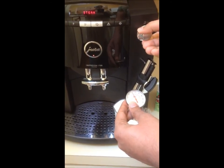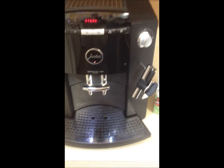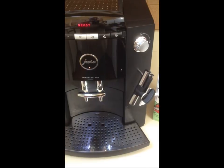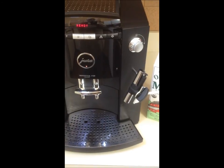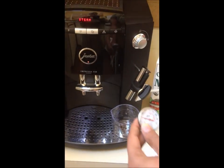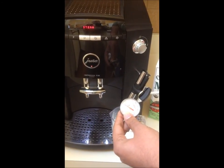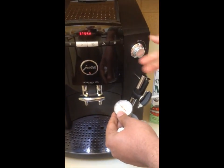The fact remains that this milk does not reach the required temperature. One reason, as a technician, I can understand is that perhaps the tube is drawing too full a volume of milk flow. As a result, the steaming temperature does not rise to the level we need. Steamed milk from the frother should reach 160 degrees Fahrenheit. If there is some deficiency, I can accept a temperature of up to 150 degrees Fahrenheit. Anything less than that is not a good feature in a frothing device.